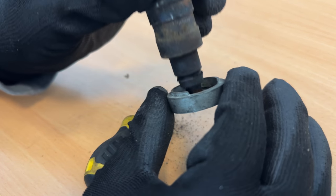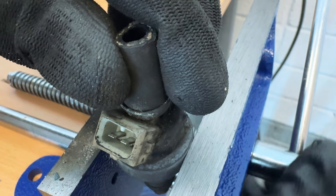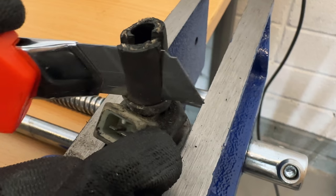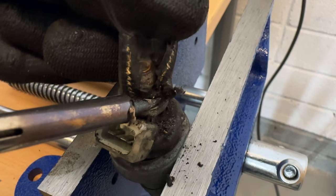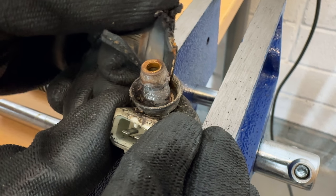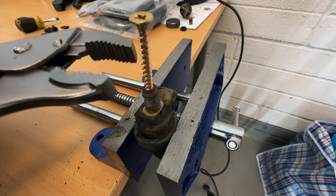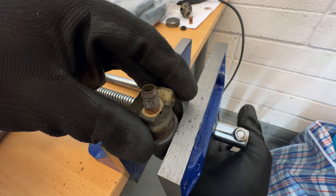Straight off the end. That allows me to remove the metal one. I'm actually going to put this rubber one back on - because I want to put this injector into a bench vise, tighten up onto the rubber piece, and not harm the injector itself. So using my Stanley I'm going to very carefully cut into the rubber hose, then go down in there with my soldering iron and melt it all away. Starting to make progress. Then the ring will come off. And now our next job is to get the filter out - I'm going to use a screwdriver, screw it in a little bit and then put my grips around it.